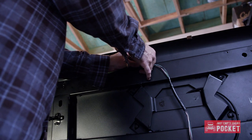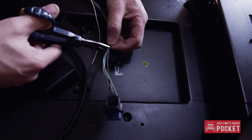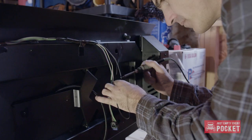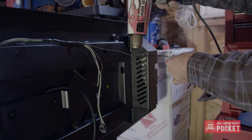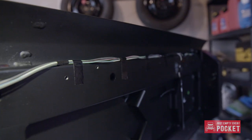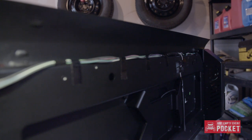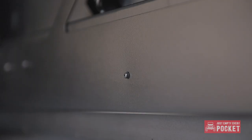After cleaning the gate off a bit I taped the wires to the top of the gate. You will need to splice in about six inches of wire — I did this one wire at a time so I wouldn't mix them up. Whether it's Jeep's fault or Smittybilt's fault, either way you have to make your wiring harness just a little bit longer. The M3 two-millimeter button head screws are just a fail. Do yourself a favor — replace those button head screws with a three-millimeter cap head screw.